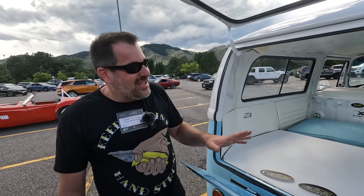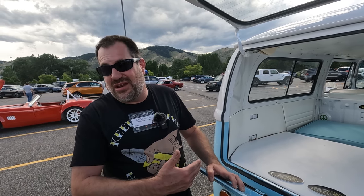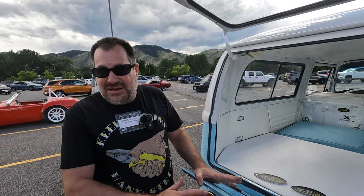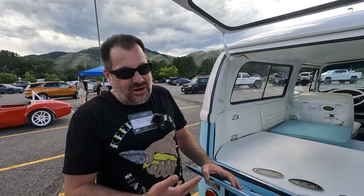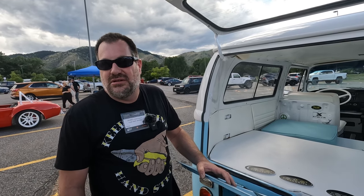What about the weight? I couldn't tell you the exact numbers off the top of my head, but we did take weights before and after, and it's not a completely different world. Actually, our typical Volkswagen conversion improves the weight distribution quite a bit — batteries up front and some behind the seat evening it out. A typical Beetle is like 30/70, but we usually end up closer to 40/60. Typical net weight gain on a Hyper Nine build like this is around 160 pounds.